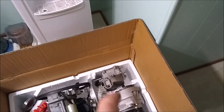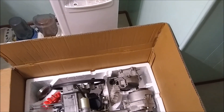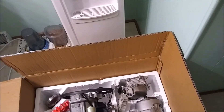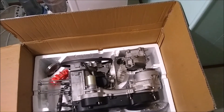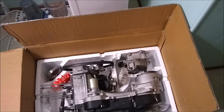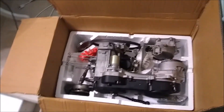I checked the transmission. I was telling you guys how I thought maybe the transmission was messed up because I was finding metal shavings in there. I took it apart and everything's perfect. It might have just been some metal shavings from assembly. It's all good now — I checked the bearings, they're all smooth, nice and smooth. No dragging, no nothing, no slop. All that's perfect.